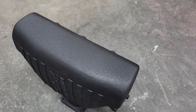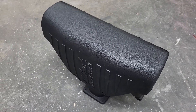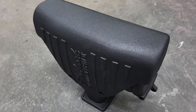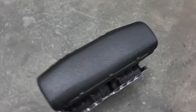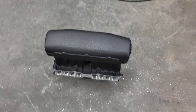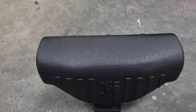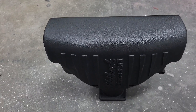This manifold now has shorter runners and flows more than an out-of-the-box Victor 5.0 set up with an 80mm throttle body tunnel. This is the kind of work we do — it's stealthy. But this takes a long time; it's a lot of work. So when people make posts about turnaround times, doing work like this with the results we get is why. Do you want us to stop doing this and just do basic stage twos only?